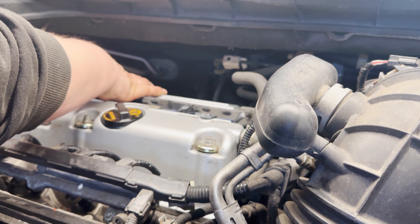We're going to remove all the ignition coil packs. Take off your connectors — there's a little push-down tab right here, just push down and pull back. It can be a little stubborn; if you pull forward then push down the tab you can probably remove them a little easier. There are four 10mm bolts, and then the ignition coils will just pull straight up.